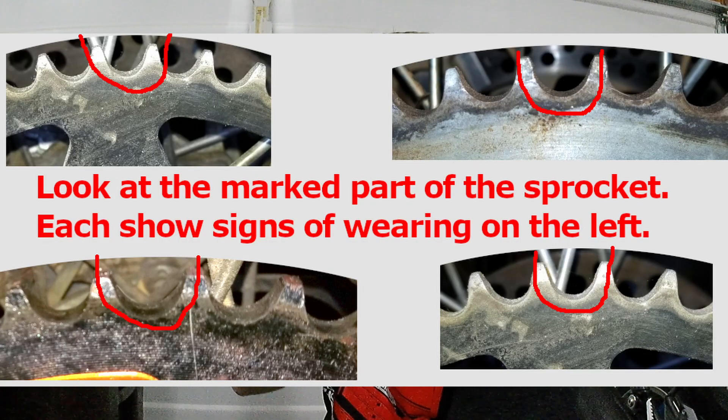One other thing I wanted to talk about — your chain. I didn't understand for a while why people always said to change your chain. I thought, it just stretches, I can take a link out. But I found out: when your chain starts stretching, it actually starts wearing out the sprocket. Your sprocket should have tight little U shapes in it. When the chain wears out, it grinds on the sides of those U shapes and spreads them out, making it more likely to slip. That's why you replace your chain. You'll also need to eventually replace the sprocket, because if the sprocket gets worn, it'll start destroying new chains.